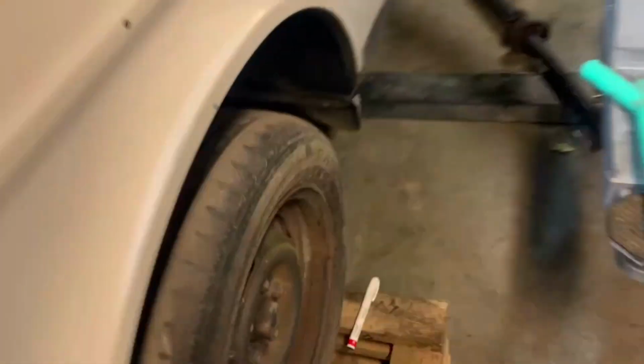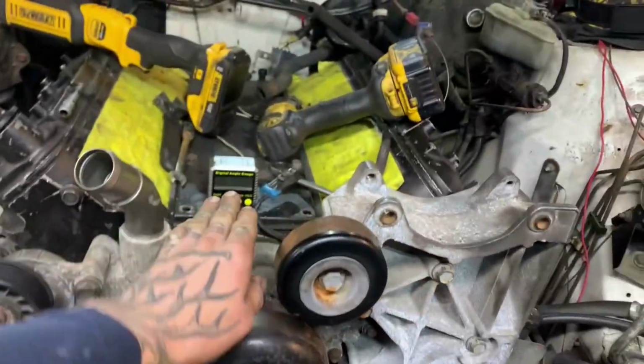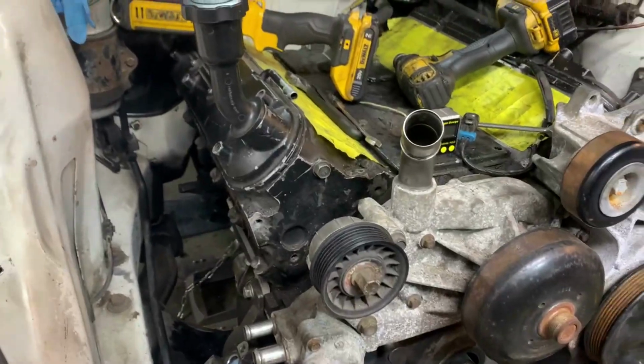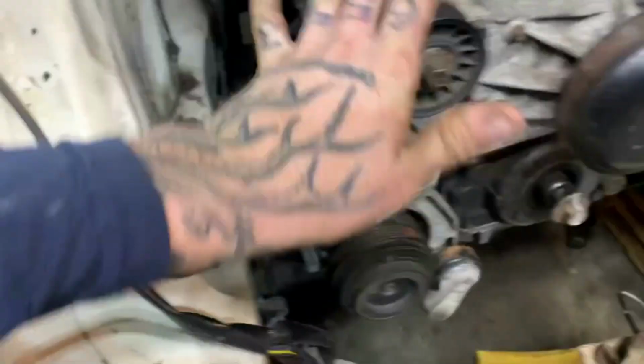Again, kind of aggravating. Stuff moves a little much. I don't know if I've moved the transmission at all. Looks like maybe a little bit, because the rear end is already at like one degree upward. So when the chassis flexes, probably with these stock bushings, it should move anywhere from 2 to 4 degrees up, which will make up the difference of where 5 ends up here, or 4 point whatever. And then when I stiffen it up a little bit, when I do an 8.8, I can readjust the rear end how I like it. But for now, she's sitting on the actual mounts.